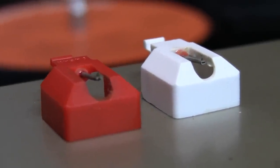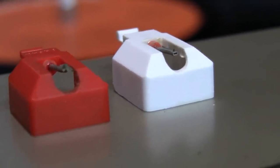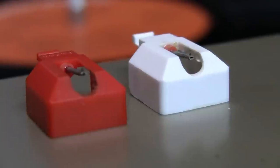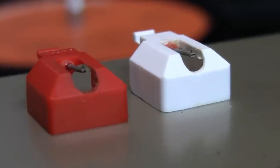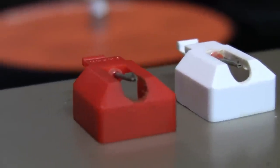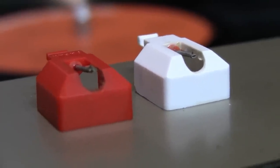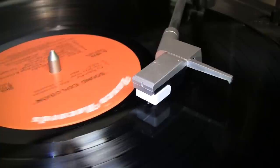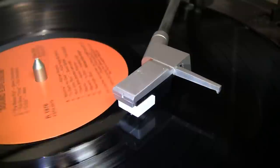So I think you'll agree that I made a major improvement in the sound quality. The difference between the worn-out stylus on the left and the new one on the right isn't really noticeable with the naked eye, but you can see a little bit of difference. The one on the right is not only a diamond stylus instead of sapphire — it's also an elliptical stylus, so you can see it has a finer point on it than the one on the left. Even just a regular conical diamond stylus would make a major improvement compared to a worn-out sapphire stylus.